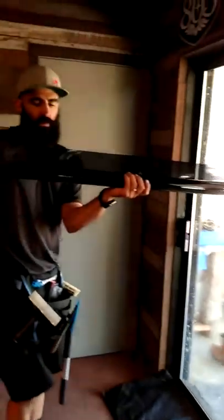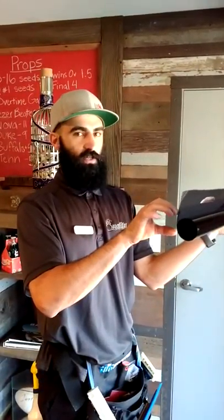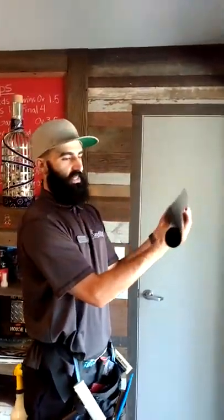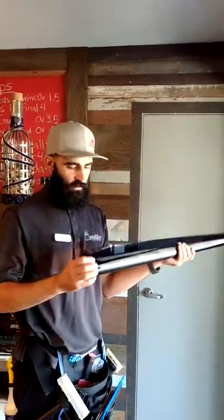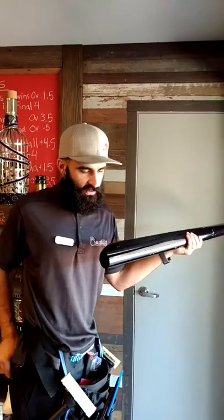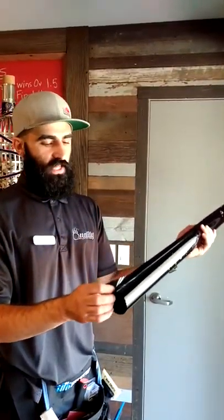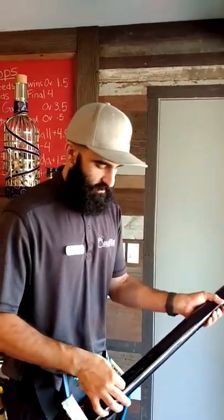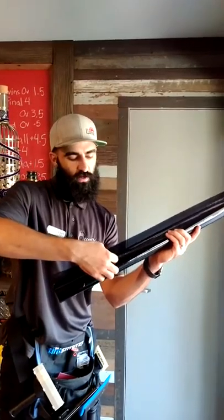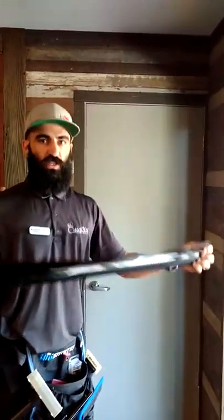Here's the trick to the reverse roll. When you have the film rolled up, you want to make sure that your roll is in front of the film. If your roll is back here, it's not set up correctly. So my liner is here, the film is here, and this roll is facing the window — if it's the other way, it's not going to work. Now I'm going to mist the liner. I'm going to split the film with my mouth, which takes practice if you're just getting started. I'll roll this up a little bit more so the liner's touching the roll and run my finger through here. Now this is adhesive, and the liner is right here on the roll — that's why I misted it. So now I'm ready to grab the adhesive, slide my hand over here, grab the adhesive, and it's going to pull the liner off for me.